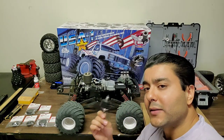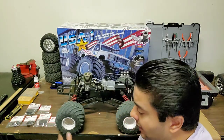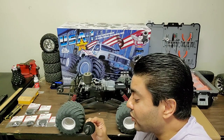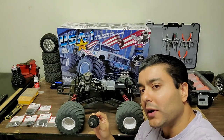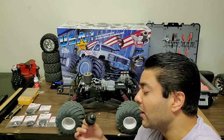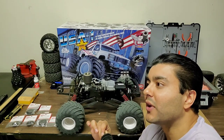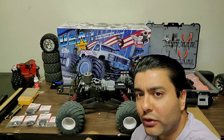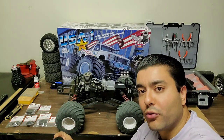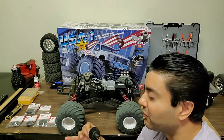I've already taken it apart — as you can see I've got some parts laid out right here. I found that the third spur gear was actually stripped inside — that's the nub where the clutch is supposed to engage. I don't know how that happened, but it wasn't engaging. I was getting what felt like a one-to-three shift sometimes, or a two-to-three shift, or even a two-to-one-to-three shift. I was scratching my head and ran like four tanks trying to figure it out.